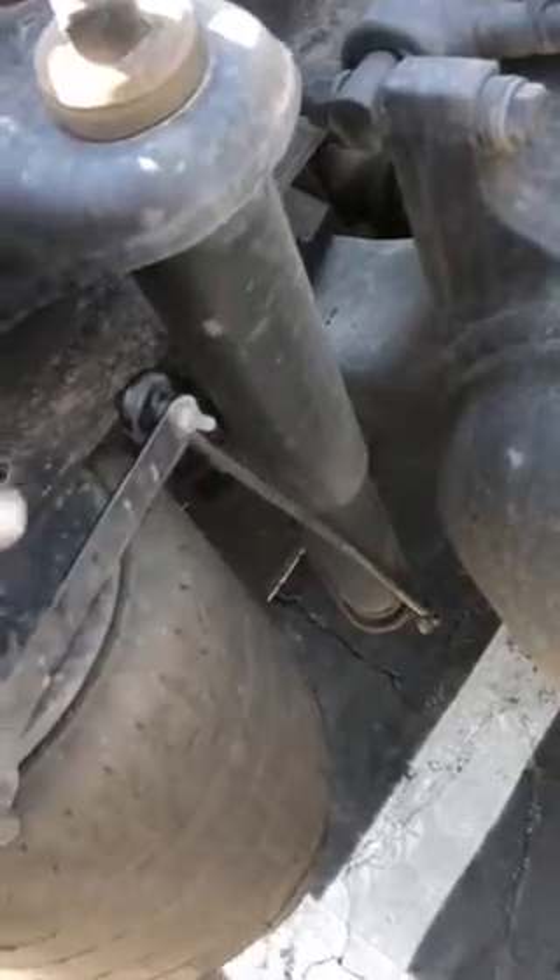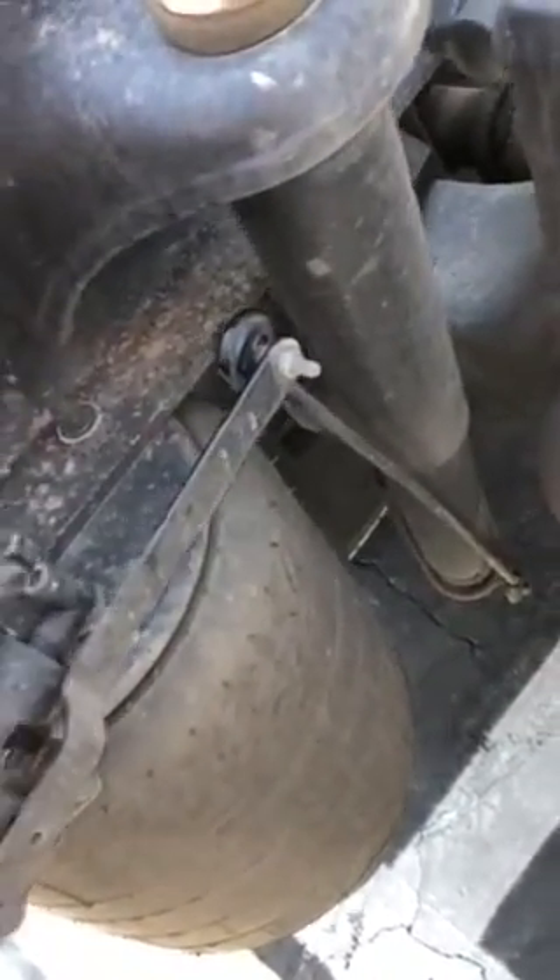So real quick, just to fix that — it's a temporary fix. Make sure your leveling valve is set, pull off the dump line, zip tie it, kink it. It's going to have air in there, but the bags will hold up. His valve does not work but he will hold a consistent amount of air in his bags to wherever the leveling valve is set.